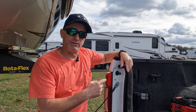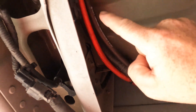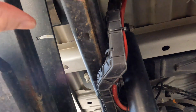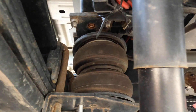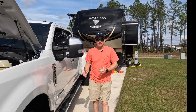I'll show you how I wired it from the Anderson plug down to the truck and all the way to the front. So we are under the truck. This is the factory loom that comes down from the trailer plug. We followed the wires back and zip tied to it. I took the ground and grounded it to the frame, and then took my positive lead and just followed the factory wire loom. Getting around the fuel tank was a pain, but as you flush through there it works — just take your time.